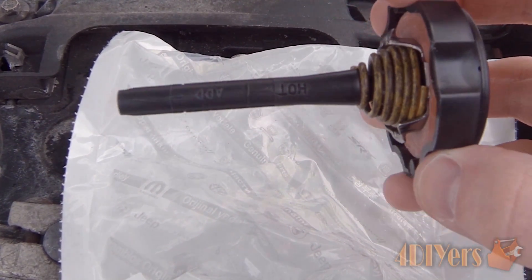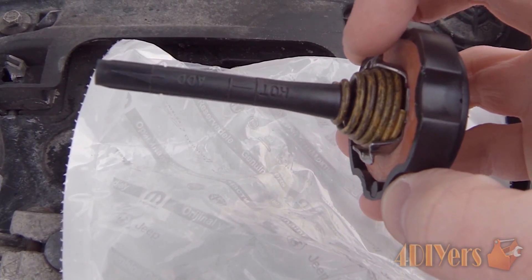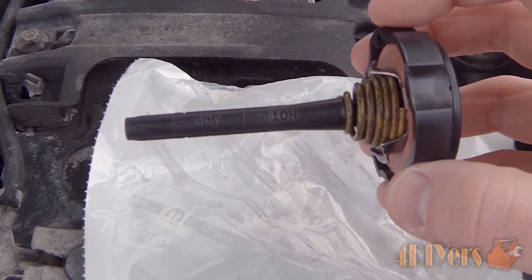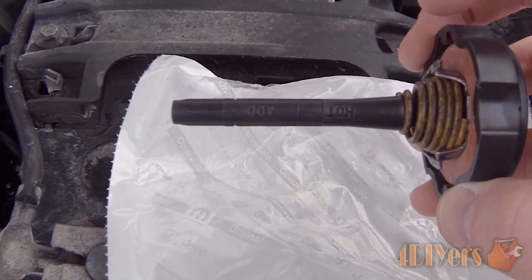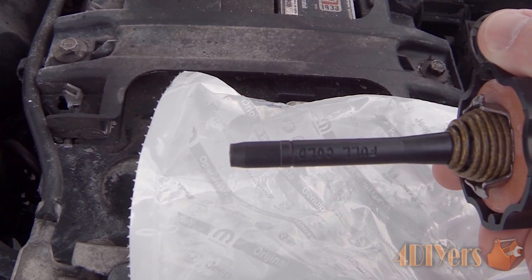As you can see, we've been having a little bit of an issue with this truck, so we went ahead and purchased a new cap. You can see there is a spring on the inside — when pressure builds up, this cap lifts up from where it's snapped into the reservoir tank and allows that pressure to be released. As you can see here, we do have a hot fill point with the dipstick, and on the opposite side we have a cold fill point as well.